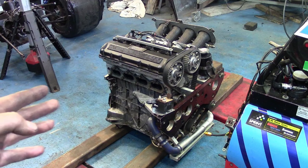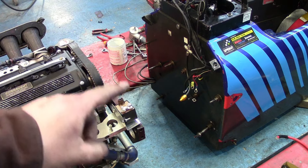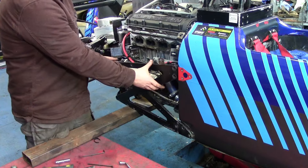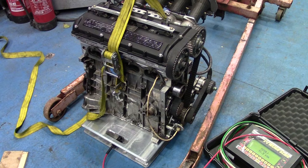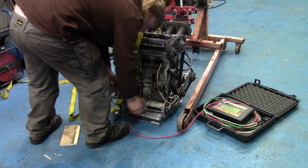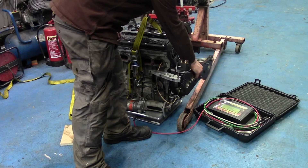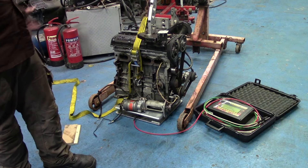I've more or less just left the engine where it was, separated the gearbox off the back of it and the tub away from the front of it. Everything splits and divides. There's not much holding the engine to the tub — there are only six M8 studs sticking out that bolt into the aluminium brackets at the front, then the big side panels come along the side back into the gearbox. I put the engine on the scales: with the dry-sump pump, flywheel, clutch, intake manifold, and wiring loom it's 91.5 kilos. It's 96 kilos with the front brackets, and 101 kilos with the starter and everything needed to hold and run the engine in the car.